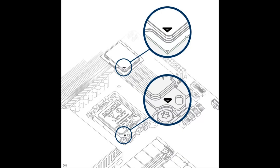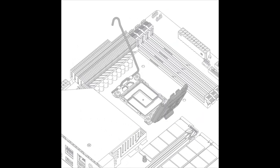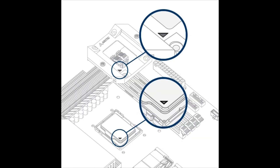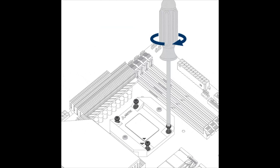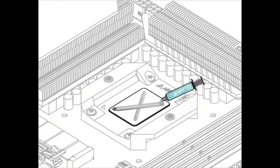For Intel sockets, removing the mainboard from the chassis is better for an easier time, since you have to remove the stock Intel Independent Loading Mechanism (ILM). It is not as straightforward as the AMD one, but the provided contact frame promises to do a better job than the stock one — kudos to Arctic for delivering it while more expensive AIOs don't. Since you can't rotate the faceplate, you're forced to position the block with the tubing at the bottom if you want the Arctic logo upright, which also places the wires at the bottom. They're not the longest cables, especially after feeding them around the water block to the nearest grommet. Considering motherboards usually only feature two fan headers side by side, you don't have many options other than to stretch your wire, so it doesn't look neat.